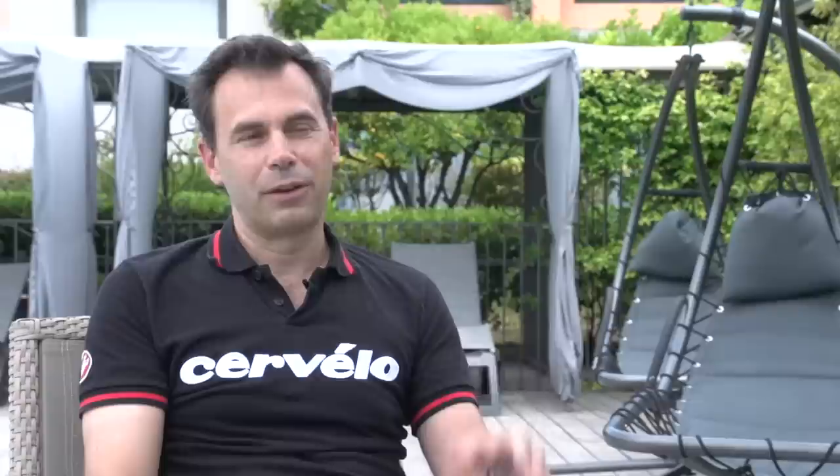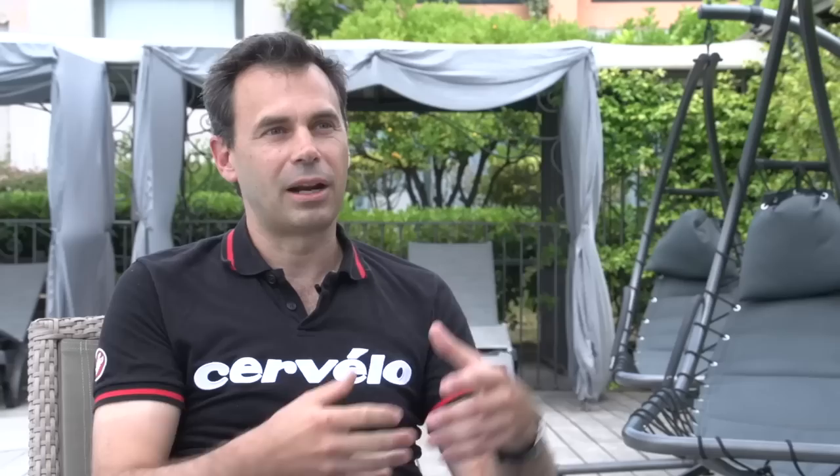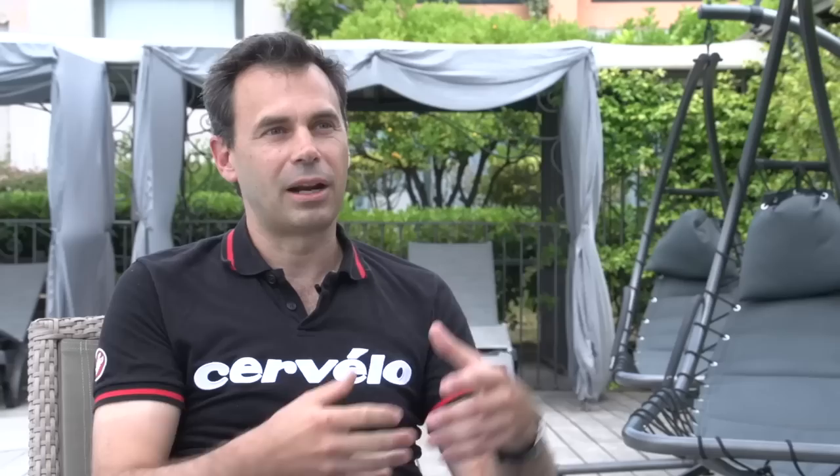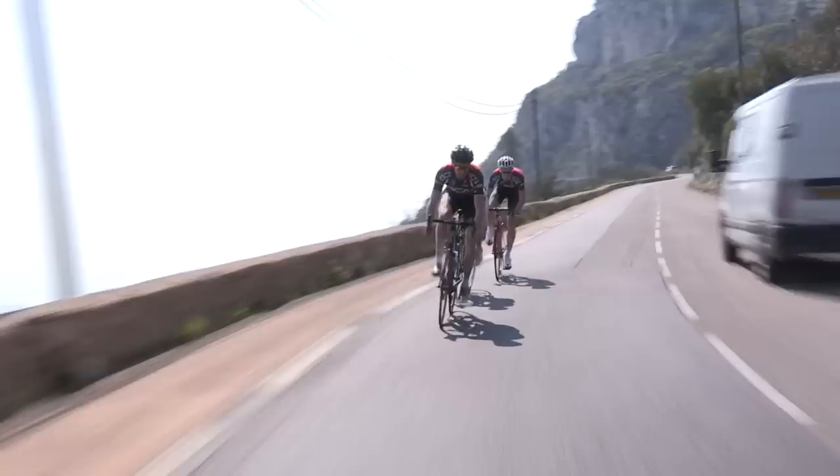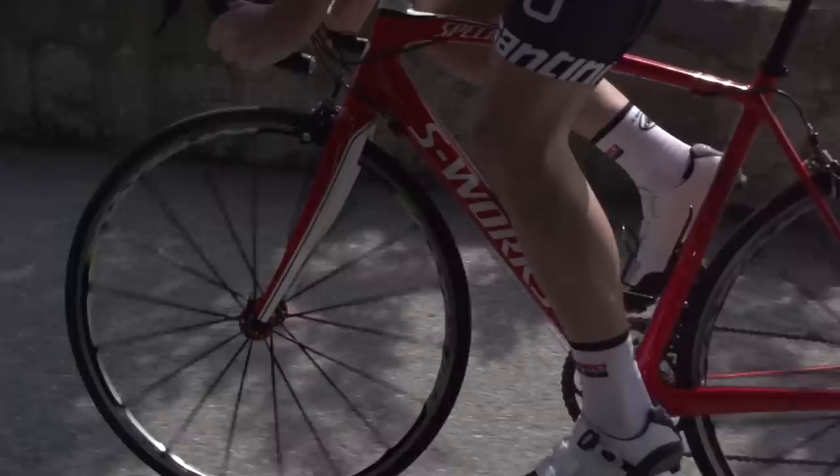For instance, if you're looking at the frame, the area behind the head tube — you want that to be really strong and actually a little bit flexible, so if you hit a bollard or a curb or something like that, it absorbs the impact and doesn't crack the frame. At the same time, you want your bottom bracket to be really stiff so it doesn't flex back and forth, so anything that you push on the pedal, all your effort goes into propelling the bike ahead with nothing wasted flexing it. In some areas you need high strength, like the bottom of the down tube, and sometimes you want high stiffness for descending so the bike tracks really nicely and you get lots of power transmission.